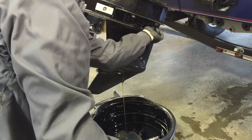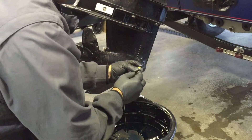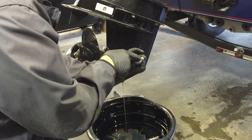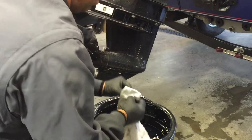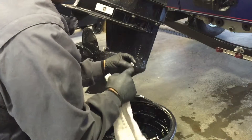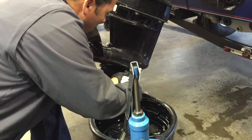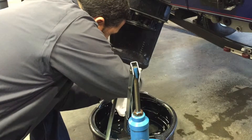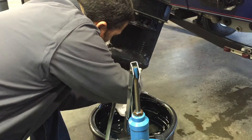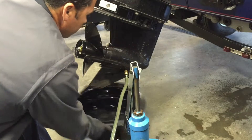If you don't see any water and just see oil — it'll be kind of thick as it comes out — remove the top screw so it'll completely drain out into your retaining pan. Let the oil drain out. If it's a colder day, below 60 degrees, it's going to come out clumpy and chunky. Give it a half hour or so to drain; go inside and watch a fishing show, then come back out and put your new lower unit oil in.